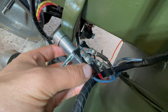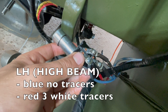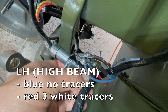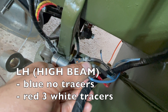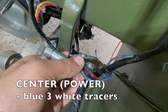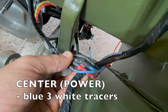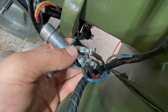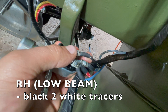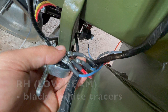It is now time to connect the wires to your dimmer switch. First we'll start on your left hand side which is for your high beams — your high beam wires are your blue wire with no tracers and your red wire with three white tracers. Moving on to the center post, this is your power terminal and the wire that connects there is your blue three-white tracer. Finally, this is your right hand post for your low beams, and the wire you connect to it is your black two-white tracer.